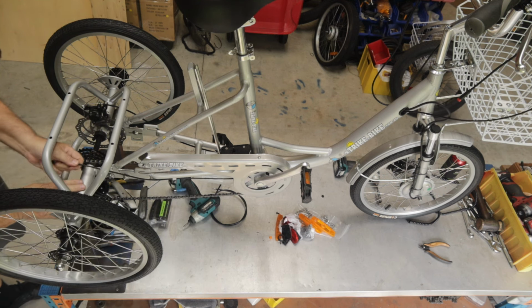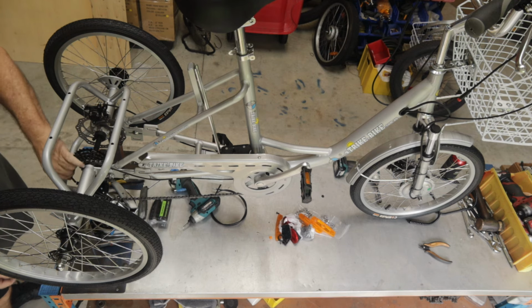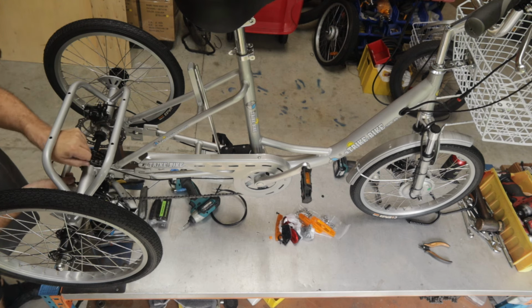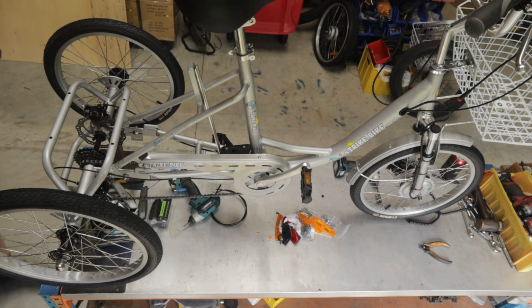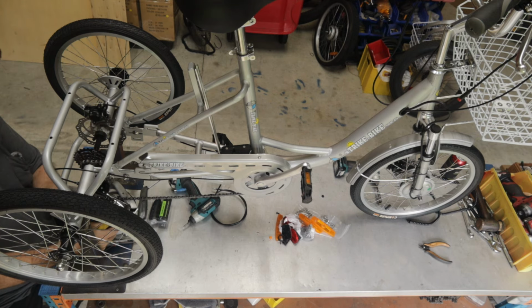I'm going to pull a little bit more cable through and I'm going to fit the cable into the derailleur adjuster. I'm going to pull a bit more through because we're still a bit tight. I like to have a fairly large loop in this area to remove any friction. Okay, so using our pliers again, I'll just get everything, and if I squeeze it hard enough, give it a tap to make sure there's nothing loose in there and all the slack is taken. I'm using an M9 spanner to release the cable clamp. Now I'm just going to tighten that up.